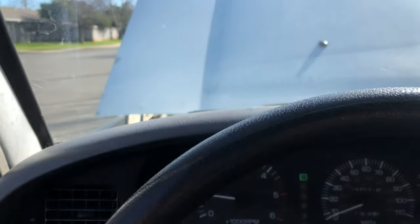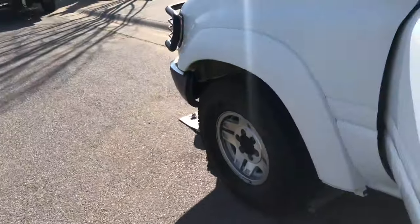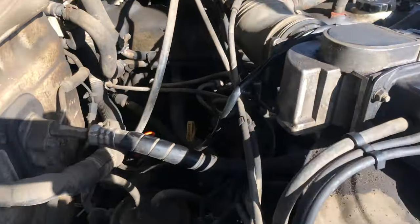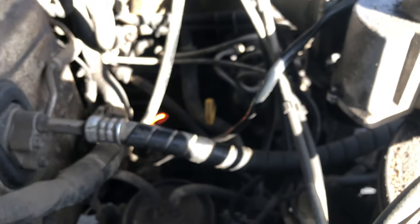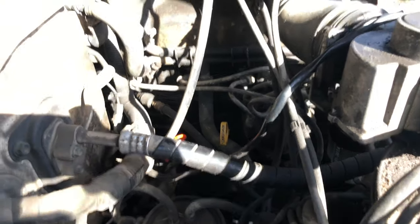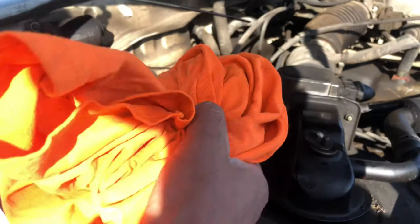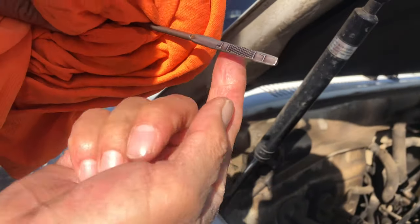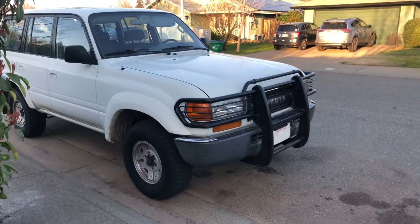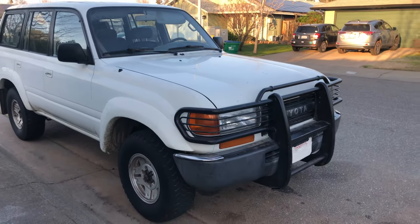It's turned on. We're going to let it run for a minute or so without revving it — just let the oil flow all the way through. Once it's been running for a while we can go ahead and check the oil levels right here on the dipstick. We're going to check the engine oil and see if it's good; if we need more, we'll put more. Oil level looks good — we are good to go. That was it, guys. Thank you for watching the 1991 Toyota Land Cruiser oil change. Hope you learned something — have a good one.